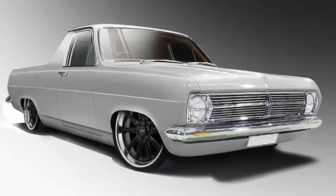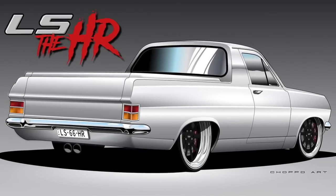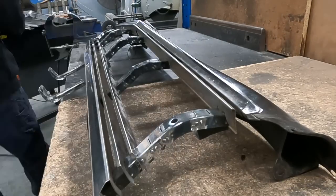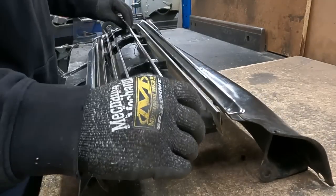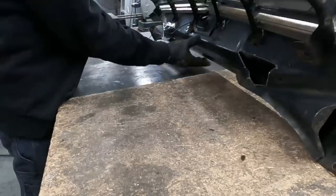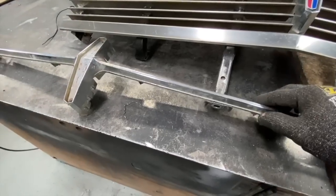The finishing touch to the front end is the grill. Right at the beginning of the build the owner had some renderings done and since then I've been trying to replicate them to the best of my ability. In the design the blinkers were deleted and the louvers ran right across. This is an old trick where if you can source a few spare grills, by removing the top and bottom louvers which are the longest, you can fit them to one grill and then delete the blinker hole. I then used another spare centre section and chopped it up and added it to the original one.